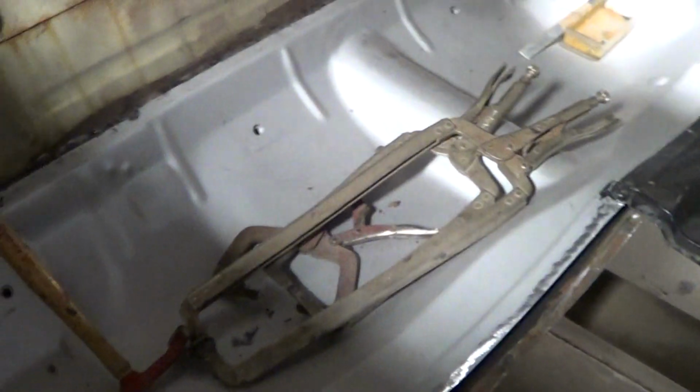So 2 of the 3 have been put in. So your seat pan is now in. Once again, all POR 15. So like here in this brace, you see that black? That is the POR 15. Now, we did not do the top of the braces and stuff, the floor braces, because the glue gets all on there, and we have to have something for that glue to adhere to, and we don't want it to adhere to the POR 15 in case the POR 15 ever comes undone.